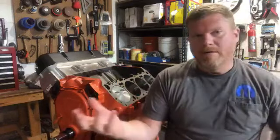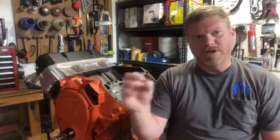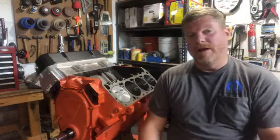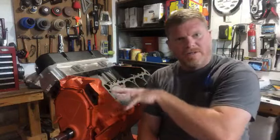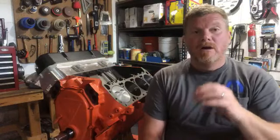I'm not going to go down the rabbit hole of what could go wrong with your engine because, again, it's another 3-hour conversation. But you could have a big chunk of carbon that gets in there and it's basically a hot coal, and that hot chunk of carbon can just be setting off the fuel kind of like a glow plug in a diesel engine. There could be an actual failure in the piston or in the engine block or something to that extent. And it's basically a hot spot that's causing that fuel to ignite at a different time and at a different pace.